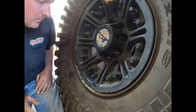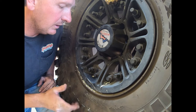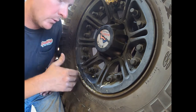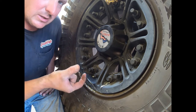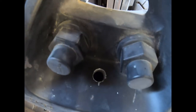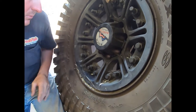Okay, that was pretty loud. I did my quarter-inch hole, and as it finished I immediately grabbed my 7/16-inch drill bit and followed through with it. With the 7/16 bit, once I punched through I went down much further because on these Hutchinsons there's a big piece of rubber in there — I wanted to penetrate that rubber with the larger drill bit. Now there's a big hole going all the way through the rubber, so we're going to jump into tapping.